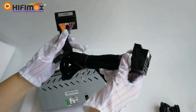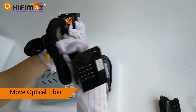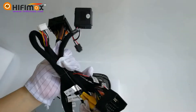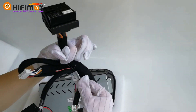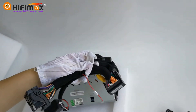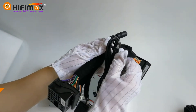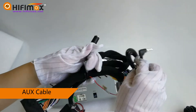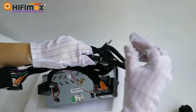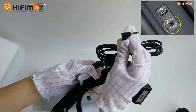If you have an optical fiber cable in the car, you have to move the optical fiber cable to these holes. You need to find the audio out cable from this harness and use the AUX cable to connect to this audio out cable. This port goes to the original AUX jack.